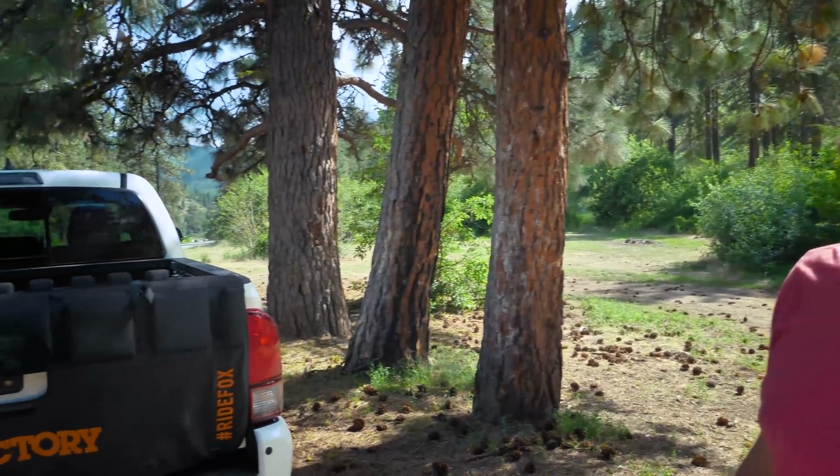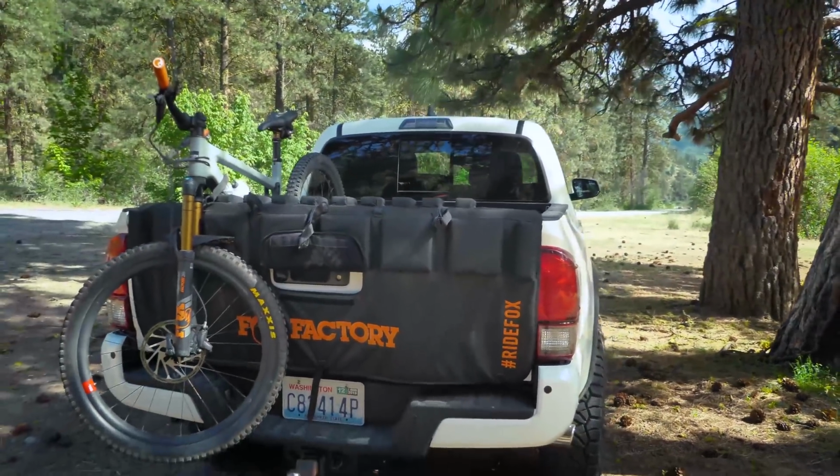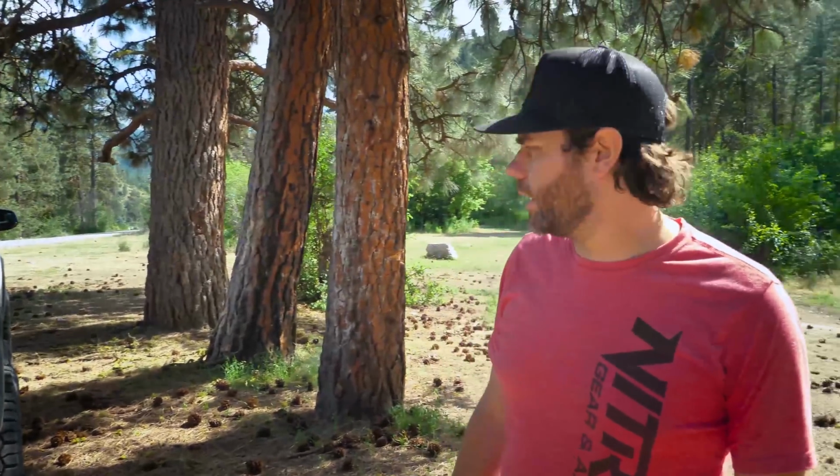Oh, one other thing too is we've got RCV chromoly front axle shafts. They've redesigned their CV axle lineup after not offering the IFS ones for a while, and I've had them in there for quite a bit now and no issues. They're working really great, which is a good thing because the Tacomas definitely have a tendency to break CV axles with bigger tires.